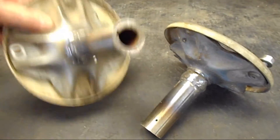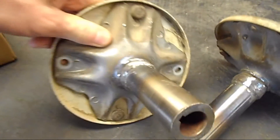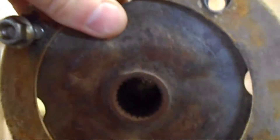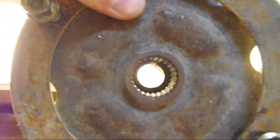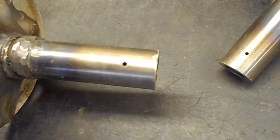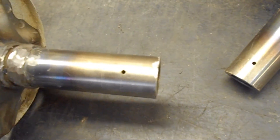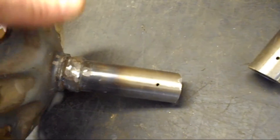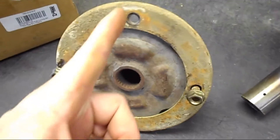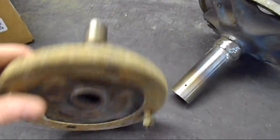Here are the rear hubs after finished welding — got them on straight, hopefully welded straight. Really won't know until I put them on. As you can see, the little key on the end ain't gonna fit up in there, so I've drilled a hole all the way through it — just a small hole right now, but I'm gonna drill it a little bigger, enough to get a decent-sized cotter key through the axle. That's what's gonna hold it on, and then the bolts are gonna hold the actual wheel on. Let's go put one of these on and check it out.